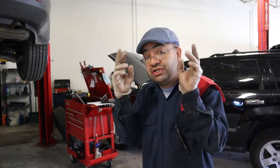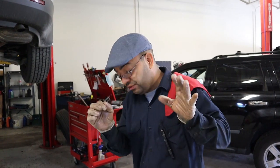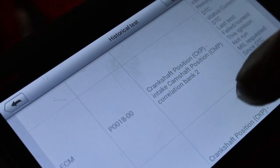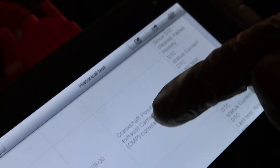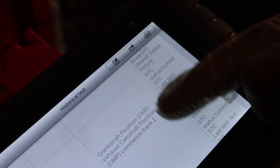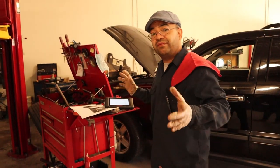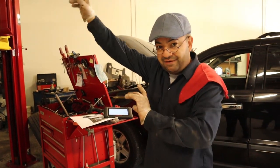then you want to check this first before you go ahead and replace your timing chain or the timing chain components. So here you see the codes — P0016 is crankshaft/camshaft correlation, P0017, P0018, P0019 — all of them are crankshaft/camshaft position correlation codes. It's telling you that your timing chain is not synchronized between the crankshaft and the camshaft.